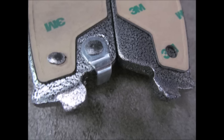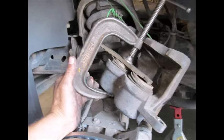That tab you want to put on the piston side of the caliper. Here's the caliper and a C-clamp — I take one of the old brake pads and alternate back and forth between the two pistons, making sure I'm putting them down evenly. That's the reason we took off the cap on the master cylinder to begin with, so we don't explode it. One other tip: only do one side at a time. If you compress both pistons simultaneously, you can push out the pistons on the other side, and getting them back in is fairly difficult.